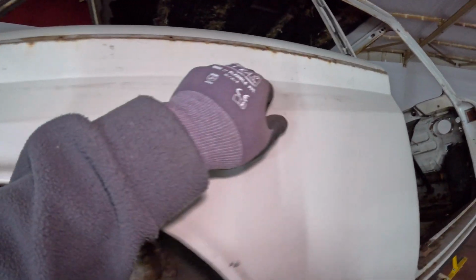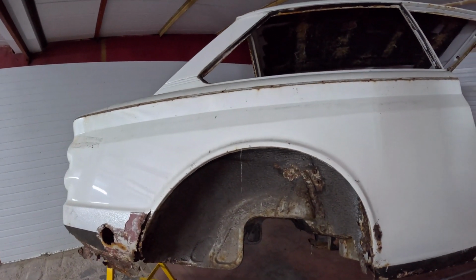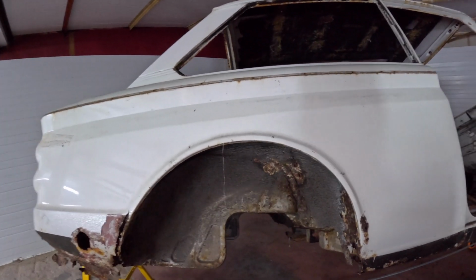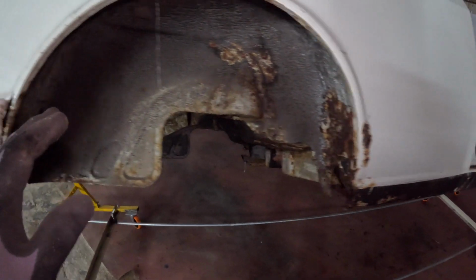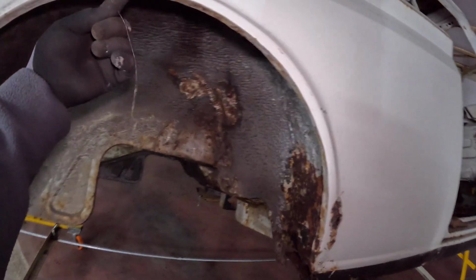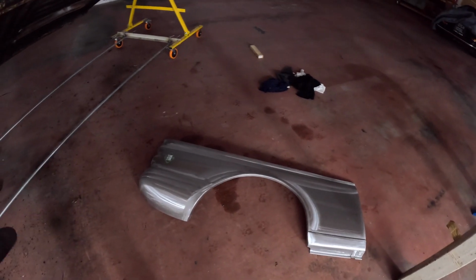all the way along. Now there's a few ways you can go about that. Workshop technique, entirely up to the individual. You'll see a little bit on how I do it later. But certainly you want to try and keep as much of this curve as you can to match up with the curve on the panel. They will need a little bit of fettling, not a lot, but once it's on, and especially if you can get your inner arch repaired to give you a datum to work from, these panels go on absolutely lovely. The biggest benefit is they only need a skim.